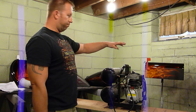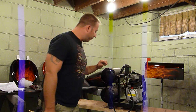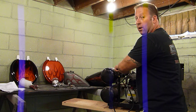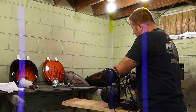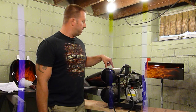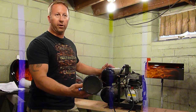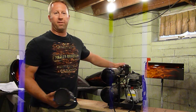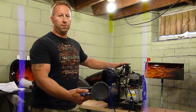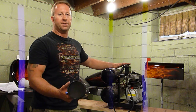I have this compressor here just to show you. Compressors typically have a rating at 90 PSI and at 40 PSI. At 90 PSI, this compressor will flow 3.8 CFM. At 40 PSI, it will flow 5 CFM. So at 5 CFM around 40 PSI, if you knock out another 10 PSI to get down to the 30 that this gun requires, you might have about 5.3 CFM coming out of this compressor. You can see that this CFM number is lower than what this paint gun needs, meaning this compressor will not supply enough air to use this paint gun for any extended period of time.